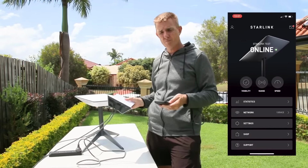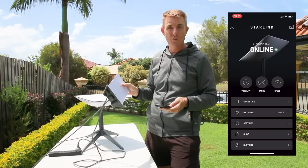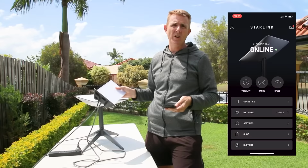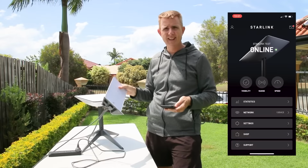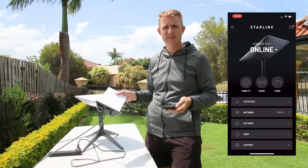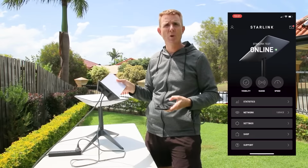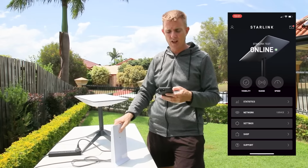The router isn't too bad, it's just wireless. It will do 2.4 and 5 gigahertz. It's only a Wi-Fi 5 router, but since you're only going to get about 300 meg tops out of Starlink, and since Wi-Fi 5 will give you over 600, maybe 1,000 megabits per second, it will probably do you. The problem you have with it is more how to extend it a bit further around your property, so we're going to help you with that.